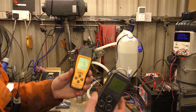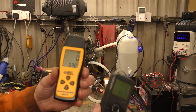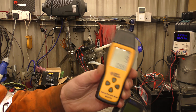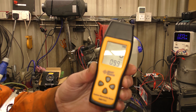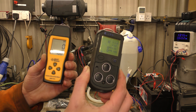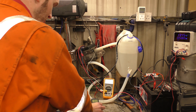Hello! Today we're going to try tuning the diesel heater with carbon monoxide by using this - the cheapest carbon monoxide test you can get. You'll notice that when you move it, sometimes it'll give you a reading. So when you're doing this, don't move it because you'll get false readings. And this is just the other really expensive carbon monoxide meter I've got, just to see how the accuracy compares of each, although they'll just be sitting on the bench near the exhaust.